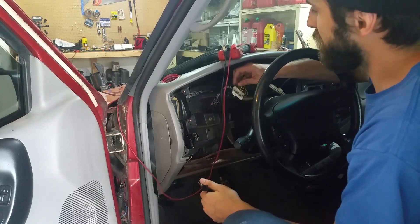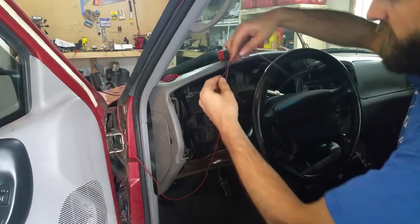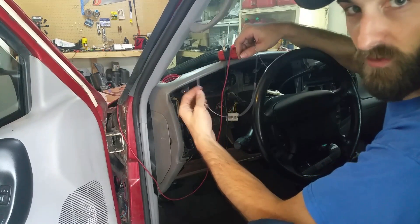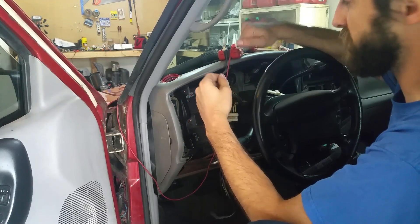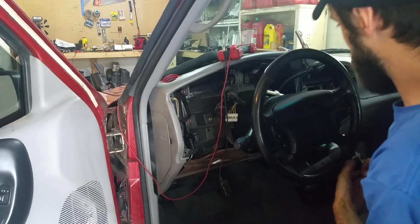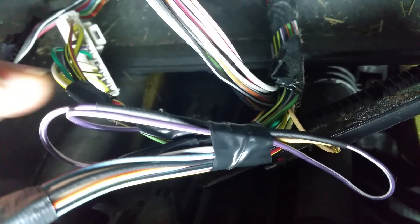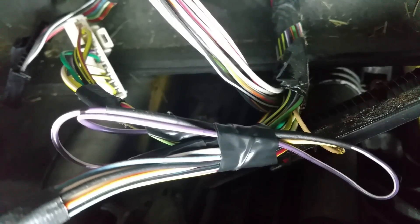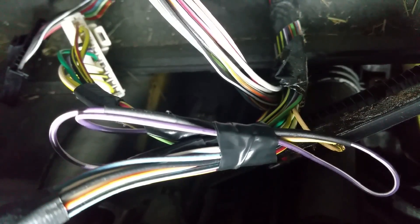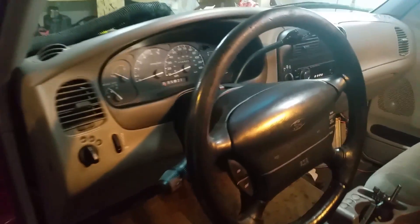A lot of these other wires don't have power but this one does. I'm going to take my jumper that I made with the resistor in it, hook it up to that 12-volt positive wire, and then hook the other end up to the tach signal wire — and that's as simple as that. Where I added in the resistor you can see the heat shrink; I stripped the wires back without cutting them, just removed the casing, and added the resistor in.